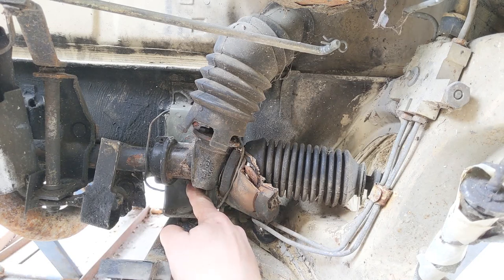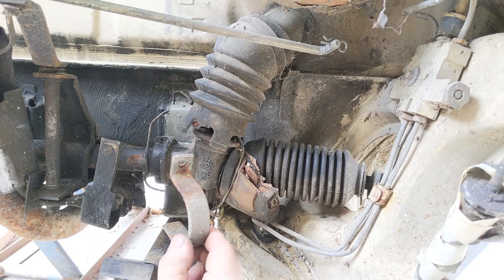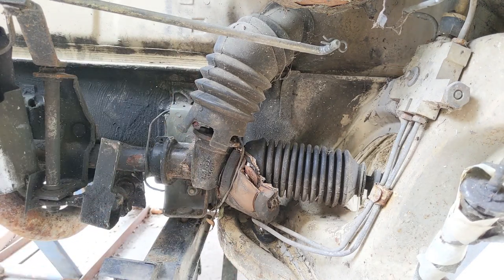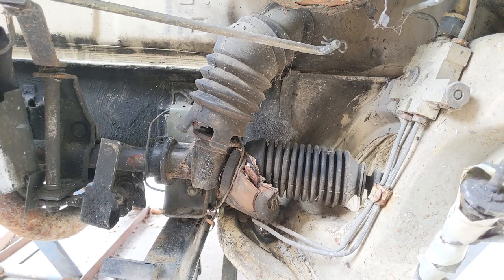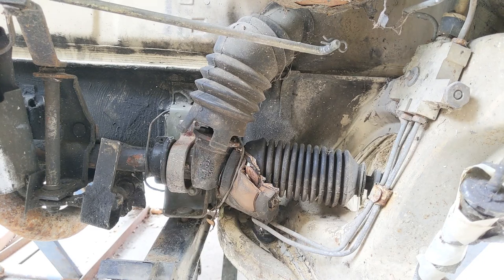So we can take off the bottom part of the bracket that's still attached and weld it back on. And then the top up here, it looks like there's actually a broken off drill bit in it or something. So they tried to drill it out and kind of had to come down at an angle, broke off a drill bit. So we'll do that, and so reattach that, and this whole shoe leather debacle will be over.